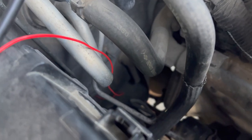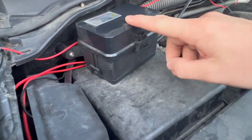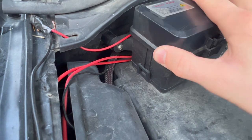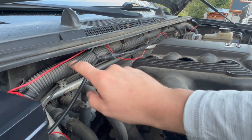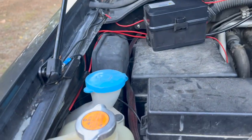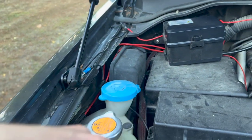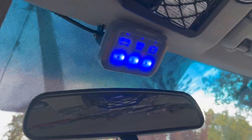Getting under the hood here, look down — that is where I drilled the hole through. I'll put the link to that forum and attach some photos so you can see a bit better what it looks like. Then for the actual switch panel, I just have a couple self-tappers with rubber spacers to give it a little space so I can still pop it on and off and access it if I need to. I chose to put the control box where it is because the positive cable that hooks up to your battery isn't that long. I've seen some people splice and extend it but I didn't want to do that, so I just have it there with all the negatives going everywhere else.